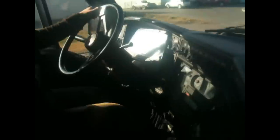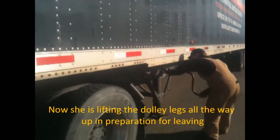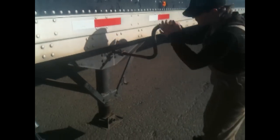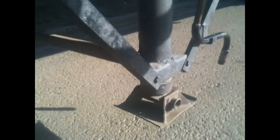You're just going to feel a slight little bump — right there. That means that my trailer brakes are working. Now I'm going to release both my tractor and my trailer, go forward a little bit, and use my hand valve to show that it's working properly. There's my hand valve — it works. Now that we know we're safe, we can wind up our landing gear, make sure that's locked in place. And that is a coupling — coupling complete.